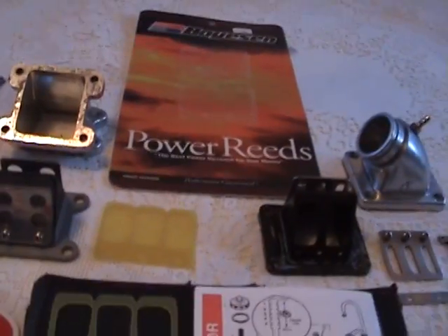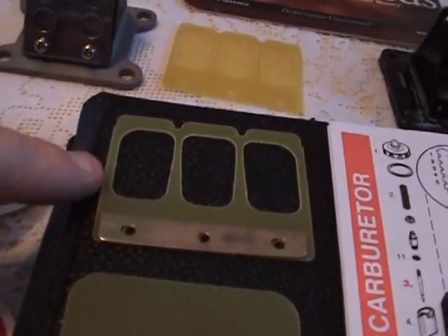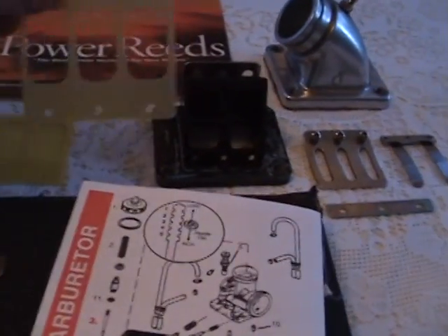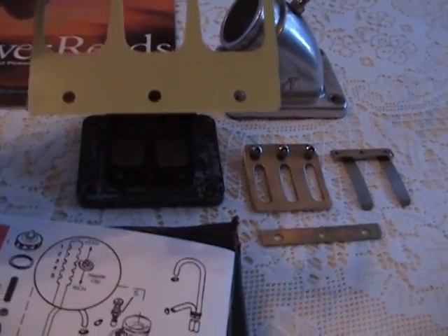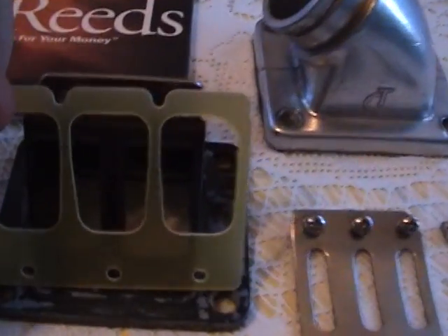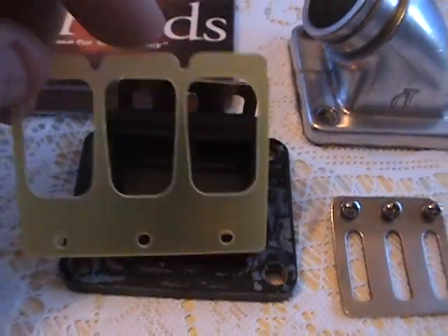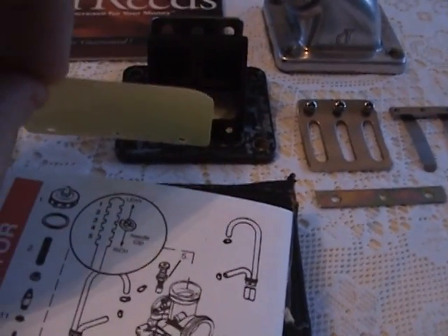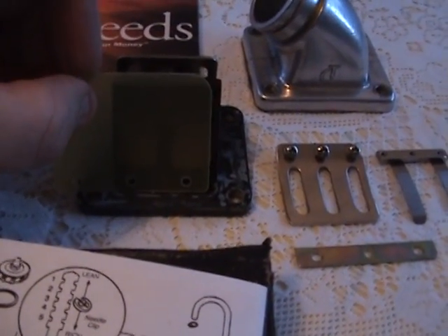Since I didn't know which size the CT intakes would cover, what I wanted to do was take the reed here and cut it right here — this is the inner part. I'll show you how it goes; the inner part goes right here. It's bigger, but what I can do is chop off a little bit on the bottom. As long as the reed matches the reed cage and doesn't overlap and let any gases out, it'll work. This is the overlay, or the top reed, and it's real stiff stuff. These reeds cost me about thirty-five dollars, and it'll go right there once I get it cut and set up.